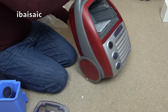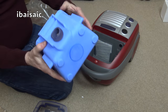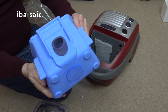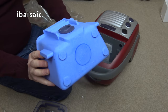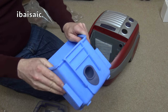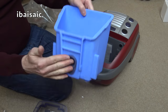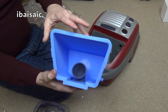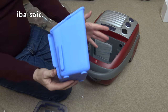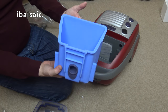Let's have a look at this eco box. You can wash it in a dishwasher apparently. It's a very odd sort of material — it looks solid but it isn't. It has very small holes all the way through it. The dirt enters through here and comes up here, so it's not really cyclonic — it's very crude. It's basically just replacing a paper or fleece bag with this plastic box.